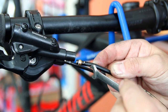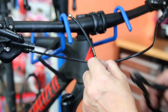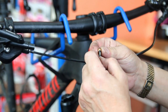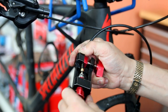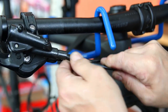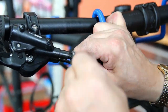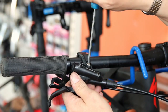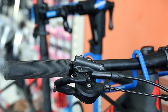I shortened this brake pipe — about five inches in the end. You can see that little crease there where I cut a piece off. That brought it into a smoother arc from the brake caliper, and also brought it in line with the rear brake pipe and rear derailleur cable, making the bike aesthetically look way more pleasing.